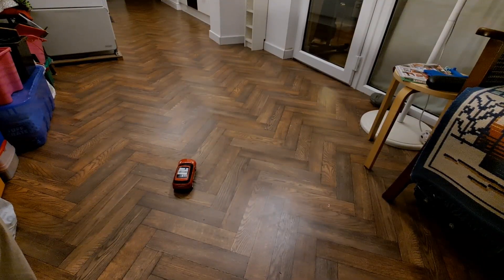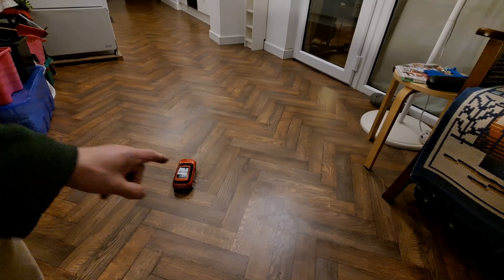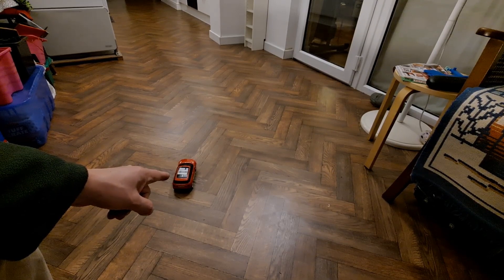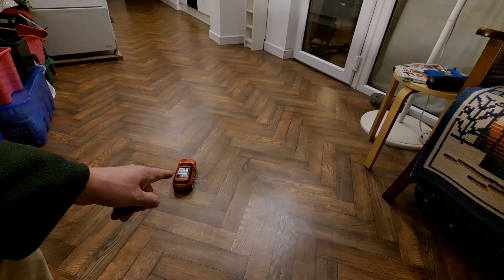Before we give it a run, I'll go through a couple of other combinations of batteries. So that one was 3 AA batteries, which would add up to four and a half volts, and we're running it on a single lithium-ion battery which was 3.99 volts — we just measured the voltage on it — which is probably at storage charge. It should be more than that when it's freshly charged.